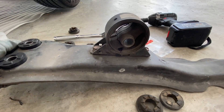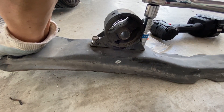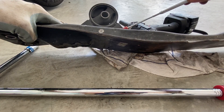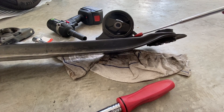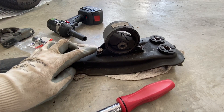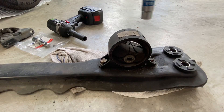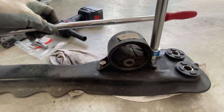I've changed the engine bush. Then I'm going to change the engine mounting at the front. I've fastened the two bolts here using a breaker bar to make sure it's flat with no gap between those sides. The circle represents the back, so this is the rear. I will avoid using the impact drill because it will actually spoil the bolt. I have a breaker bar to loosen the bolt — it can be loosened up easily, then use a ratchet. It's good to use a breaker bar to break loose the nut.